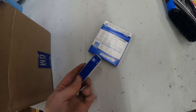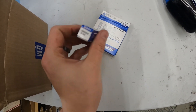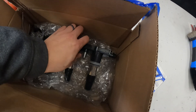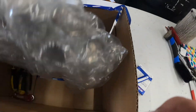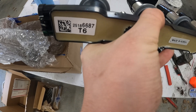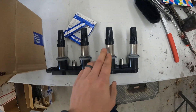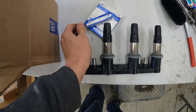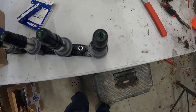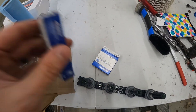When I can, I try to stick OEM — for GM parts that use AC Delco. For the spark plug, we're using the AC Delco 41-122. You only need four of them, they're about 10 bucks a piece. For the coil, I got a direct GM part as well — the part number is 25186687 — picked it up from AutoZone, they got it for us the next day. Let's do a quick inspection: you can see all these are straight, they look good, there's no play like the other one, nothing's broken. They're already pre-lubed up with some dielectric grease. These spark plugs are pre-gapped — you don't have to gap them.